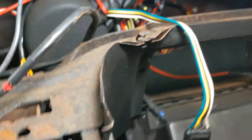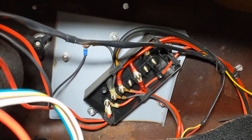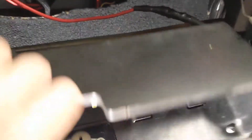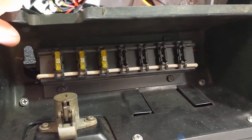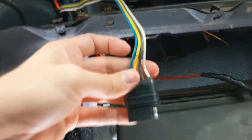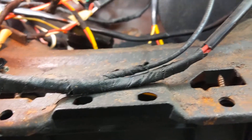I'm going to go over some of the wiring in the dash here. The previous owner installed a little junction box — just a bunch of studs with power tapped on and some grounds. Coming out of there it runs into a fuse block in the glove box with three fuses. There were four switches on the dash, three populated and one blank, so there's one fuse per switch. That comes out, goes up and around, and connects to the back of the dash. From there, there's a bunch of trailer connectors that go to gauges, MSD, and the starter solenoid.